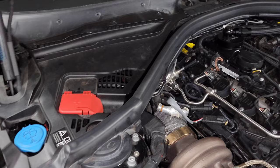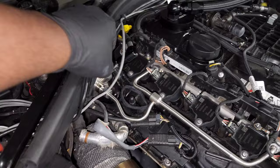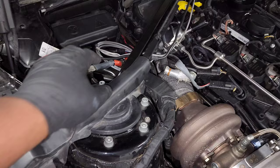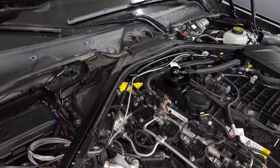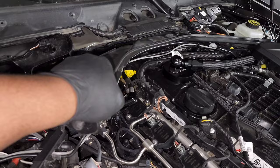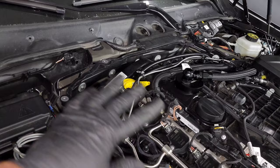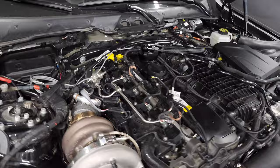Remove all your covers from the cowl area - every car is a little different. On mine, I've got three screws across the back that remove the trays on either side. Then remove the wire that goes across the rubber gasket and pull it off the strut tower. Move the strut tower cover out of the way - there's a bolt on the strut mount and one back underneath the windshield wipers. Remove those bolts on both sides, the strut mount comes off, then there's a plastic cover with seven screws all the way around. Pull that out along with any foam sound deadening and you'll have access to the intake manifold.